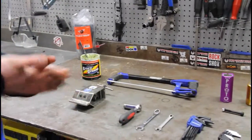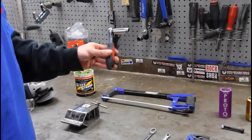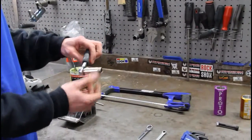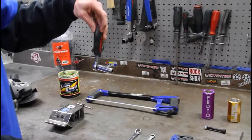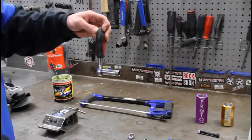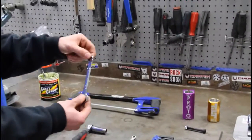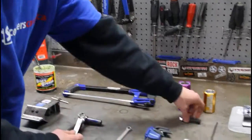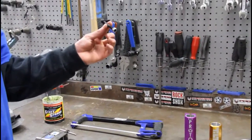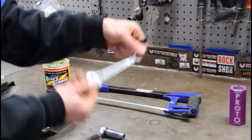Next we have some wrenches, metric only, remember. So we've got a 13mm ratchet with a 13mm socket on the end. Typically used when we're throwing on pegs and stuff. Typically you can get this right inside the peg, tighten on your nut. Works well. 13mm wrench, the other side of your axle without a peg. Typically 99.9% of scooter axle nuts will be a 13mm wrench.